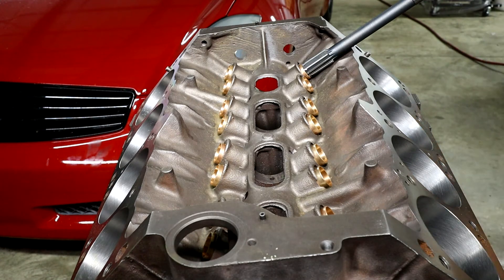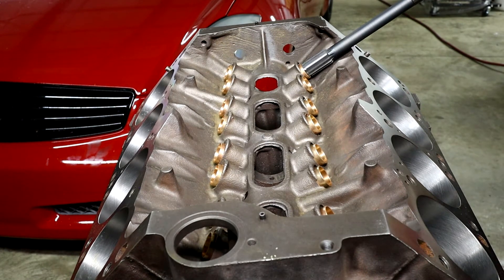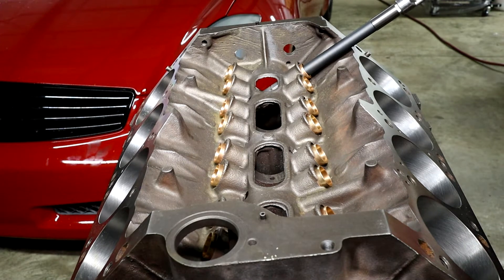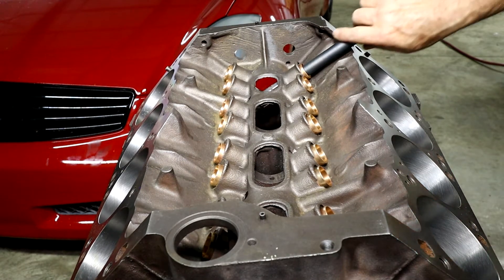Here's what it looks like — we're going to do this in real time so you can see how easy this is. Nice and easy, not too much pressure. And as you can see, that bushing is not spinning. Not taking a lot of force to do this. Again, no lubricants — it's not needed. And we are through.